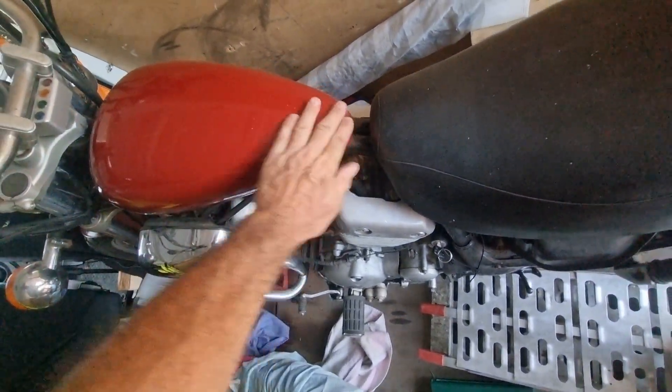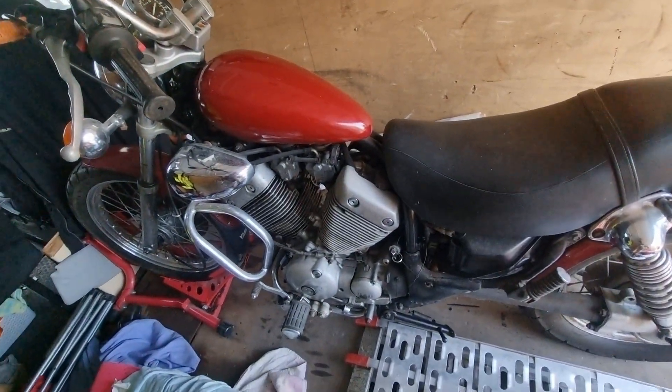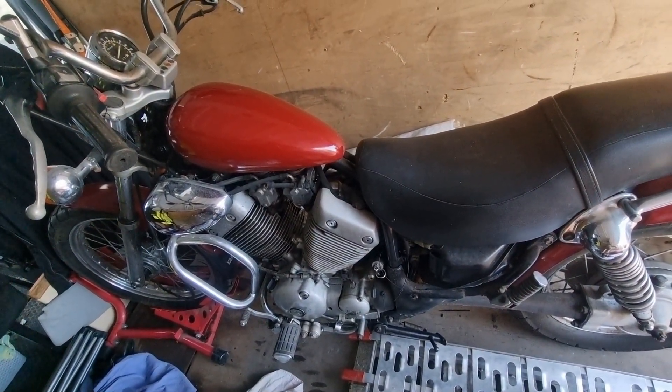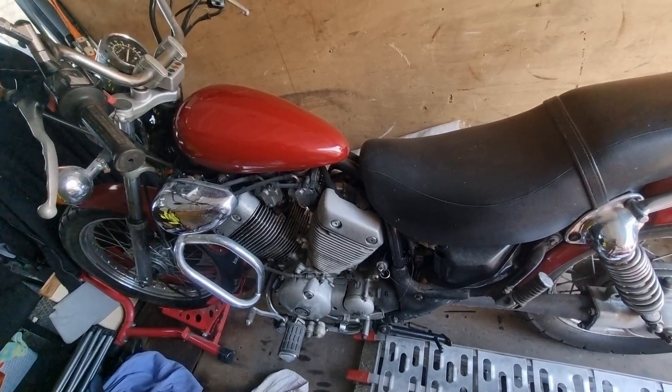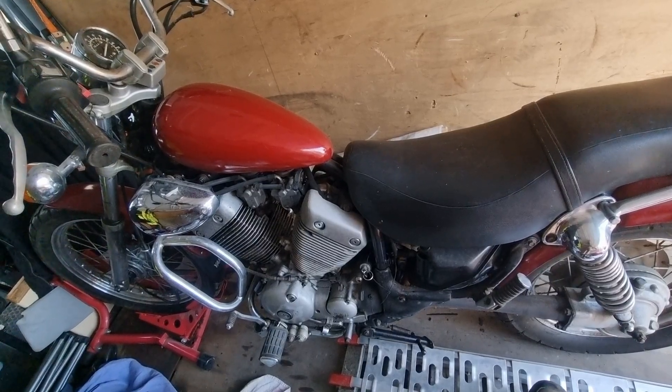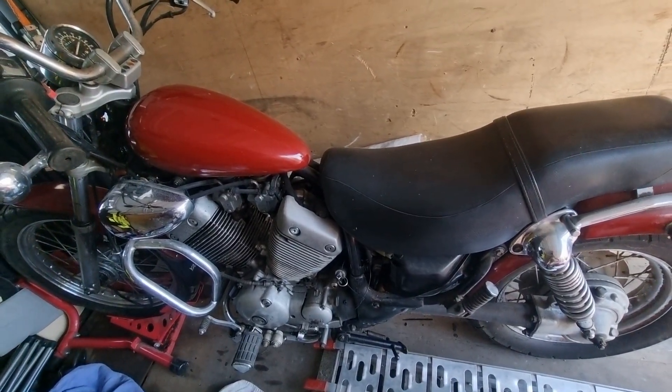This is not a professional paint job, but it's all right — I reckon it will clean up okay. Got all the usual things to check out: check the fuel, clean the carbs, make sure there's no petrol in the oil, because this particular model is prone to that happening.